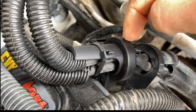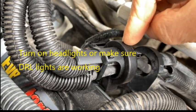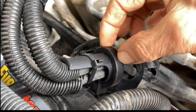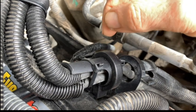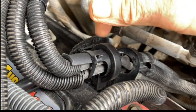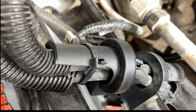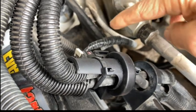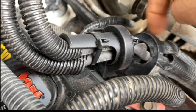Turning the headlights on kicked me into having removed the DRL fuses, because I didn't want the DRLs running all the time and burning up my lights. Unfortunately, that caused a ton of headaches — it's really annoying because eventually it'll drop down to 12.5, and then it kicks in automatically. It's a headache to see that needle go down or the digital readers drop, and then eventually come back up. Putting the DRL fuses back in with the headlights on keeps it consistently at 14.5 to 14.8 volts — it never goes down.